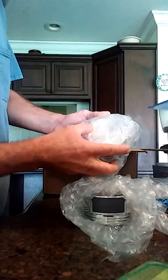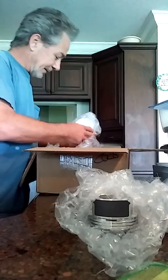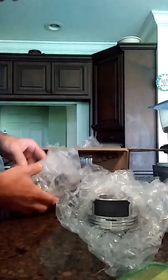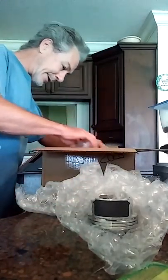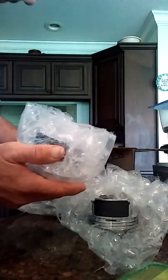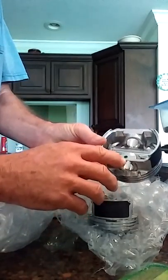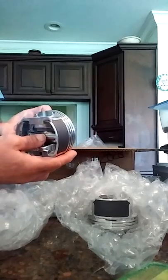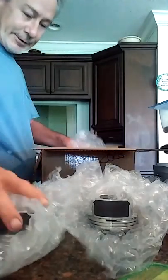Another piston, stamped 0.050. Another piston — 050. And they got the wrist pins in them. And the fourth piston with the wrist pins. They got a little green dot on them — I don't know if you can see that. I guess that's so they'll be inserted right, this direction and this direction. I'll have those put on today. That's all four pistons right there.